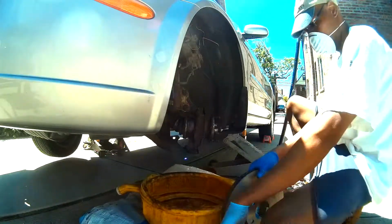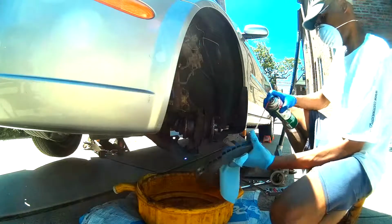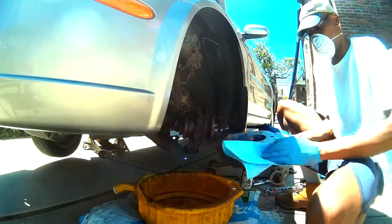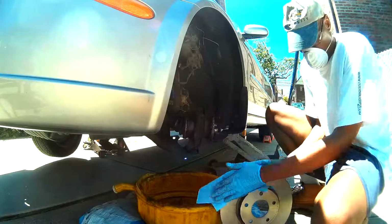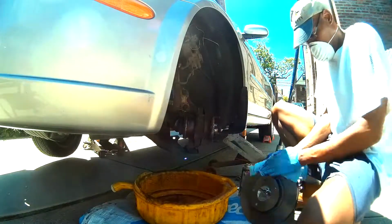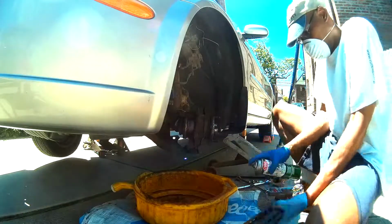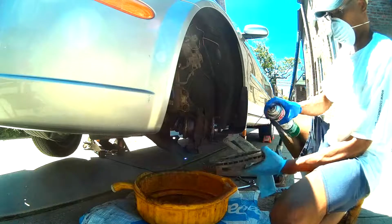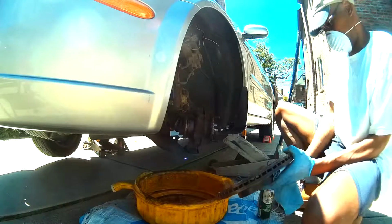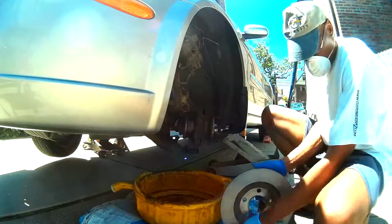During this portion of the video, we have brought over the new Brembo rotor. These particular rotors need to be cleaned off before they're mounted because of the way they're packaged. So here you see me using the Brakleen, and eventually we'll bring that over and use our sandpaper and block to prep these up for mounting.